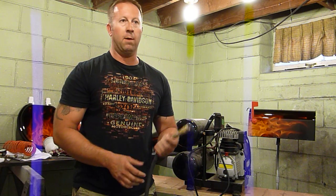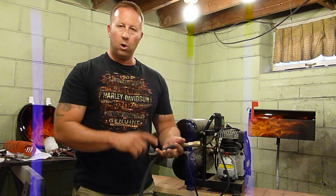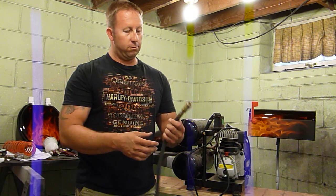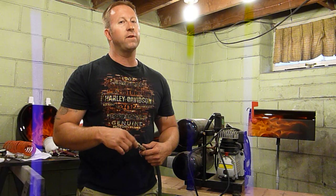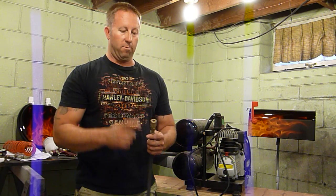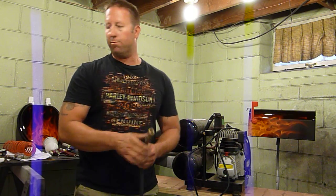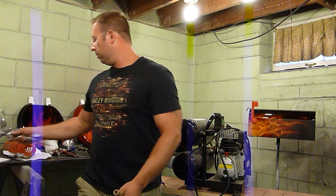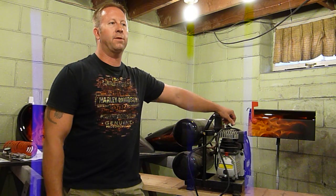Milton is a U.S. company that makes air fittings — you can probably find them at Tractor Supply, Menards, Home Depot, Ace, True Value, home improvement stores. The standard quarter-inch air fitting should be enough for a paint gun that's around 12 CFM or less. Some of your HVLPs that want really high CFM, you might want to look into a high-flow fitting from your compressor all the way through to your paint gun, including the fitting on the paint gun itself. For those HVLP guns that require a ton of CFM, for somebody that's a hobby painter, I probably wouldn't recommend it.